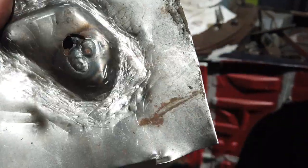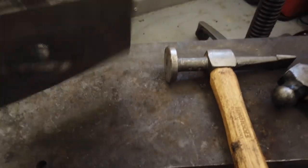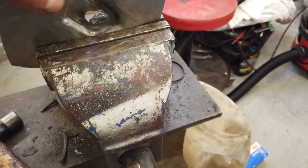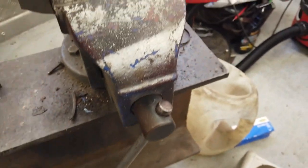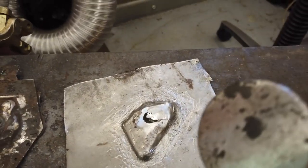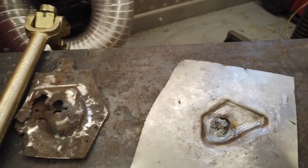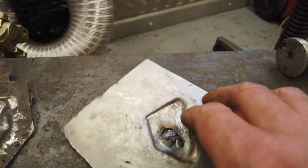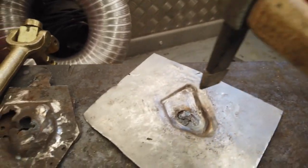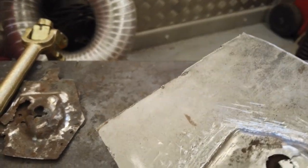We're on the anvil now on the bench, just knocking this into shape. First job: flatten out the steel. I use the vice and just keep turning and crushing it - initially rotating around, flipping the vice just like this, squeezing up on the handle, squash. Then use one of these hammers to shape it, going around into the corners, flipping it. You can see where it's trying to not be quite as pronounced - tap that back and get it really nice and straight. Don't worry about the blob of weld - that was necessary to fix it. See how it's getting nice and square now.